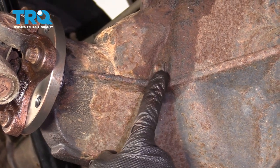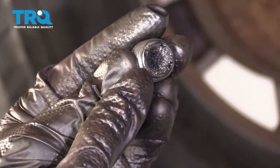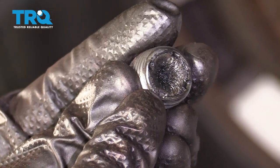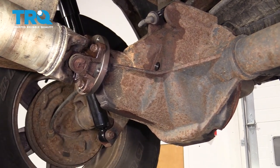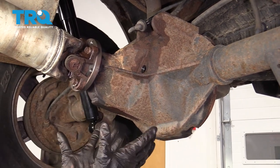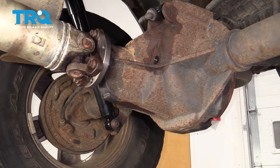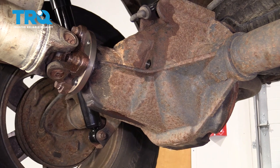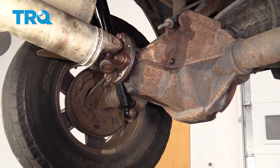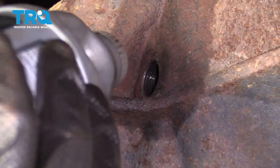Next, we're going to come up here to the fill plug — go ahead and remove that, and we're going to fill it with the manufacturer's specified fluid. With the fill plug out, you want to inspect the magnet area. Typically you're going to see a bunch of little metal deposits, but if you see large shards, you probably want to take off the differential cover and make sure everything's okay in there. For the rear differential fluid, there are two options: 75-140 or 80-90 — it depends on your application. If you have a limited slip differential, use 75-140 synthetic oil and also make sure you use four ounces of friction modifier. If you have an open differential like we have here, go ahead and add 80-90 gear oil. When we fill this, we're only going to fill it so there's a small trickle coming out, and then we'll clean up our fill plug.